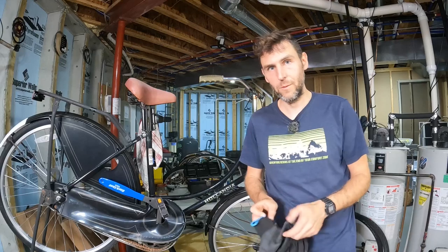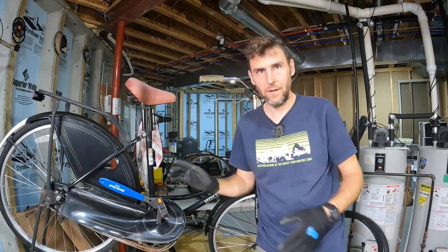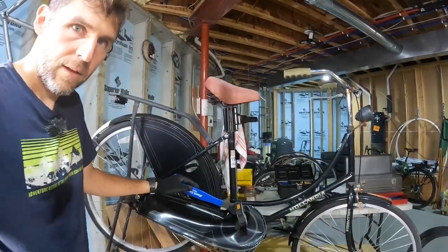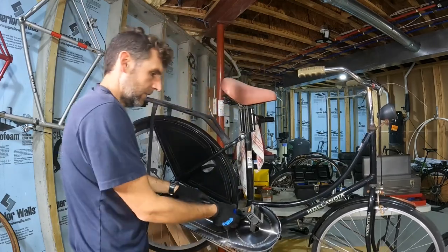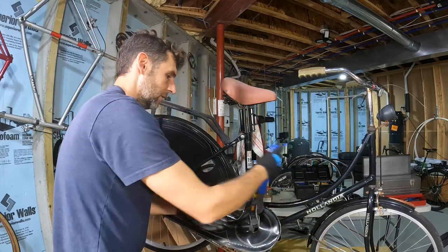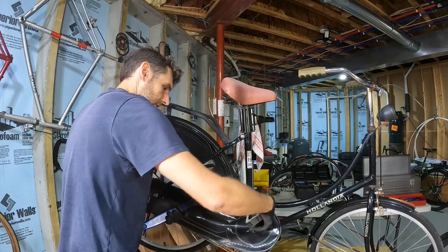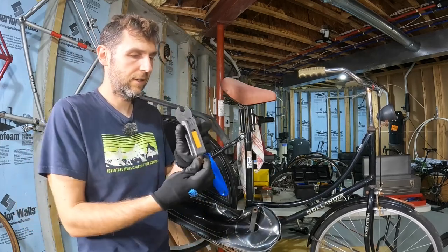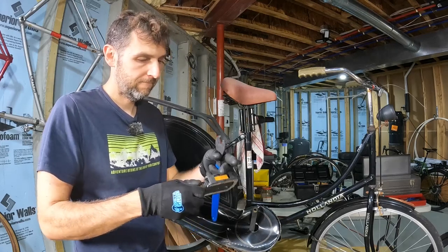Let me get some gloves on because I have too much experience hitting my hands after trying to get a stiff pedal off. And because the bottom bracket is seized I can't rotate where the crank arms are — oh, that was actually not at all seized! Well, that's good. That gives me hope for the bottom bracket. I'll probably replace these pedals as well because they're kind of rusty. The bearings aren't terrible, just a little stiff. I could dribble some oil in, I could rebuild the pedals, I could replace them — maybe I'll rebuild them.